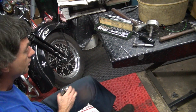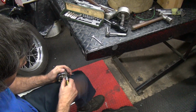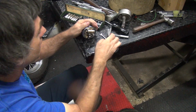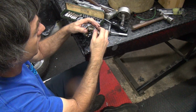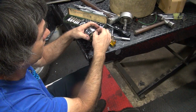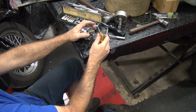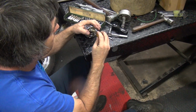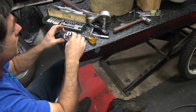Screwdriver there. So now we've got to go up here and redo stuff a little bit. See, when you short out the points, now the power goes to the system. I did have the connection off, didn't I? Yeah, it's off. So you just have to look back to see where the problem was.